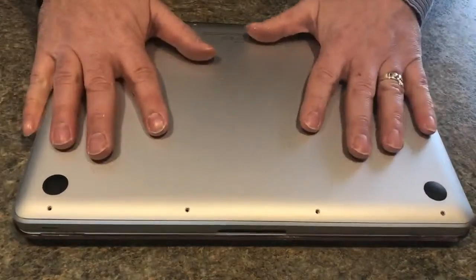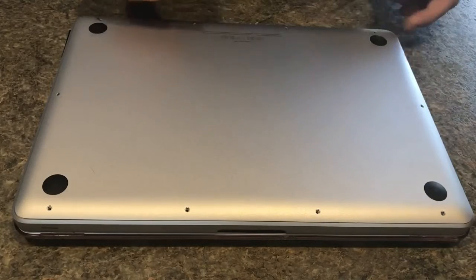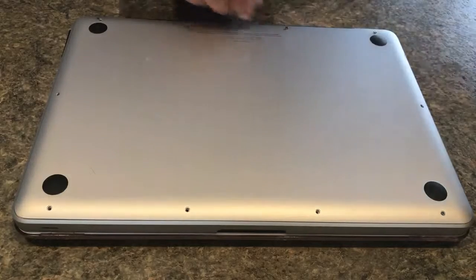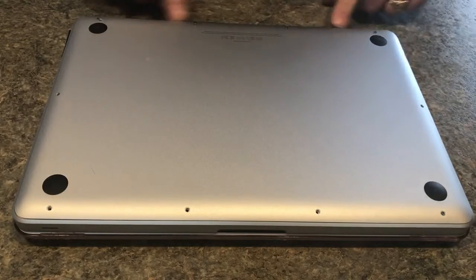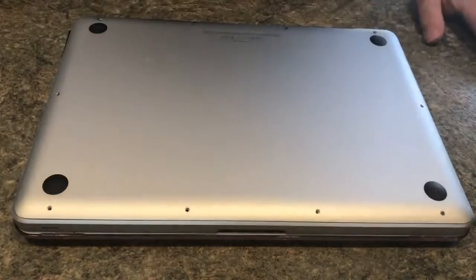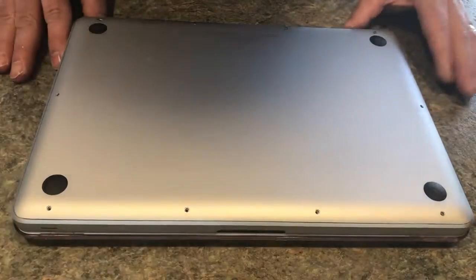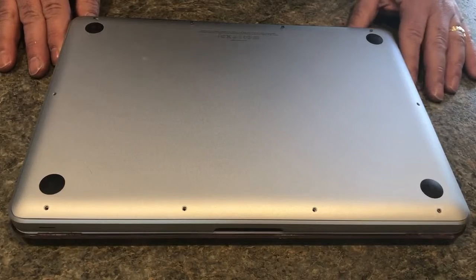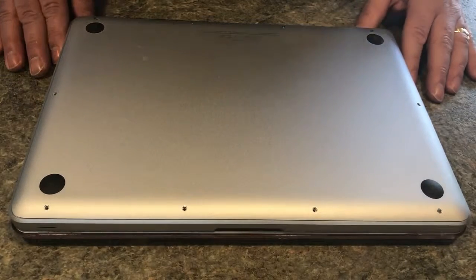All you've got to do is put the cover back on. These three larger screws go here near the power connector — one, two, three — then the smaller ones are inserted in the other positions. I hope this video helped you guys and I hope it works for your MacBook Pro. If you have any questions, leave them in the comment fields below and I'll try to answer them the best I can. Remember, a funk can do, so can you. Peace guys.